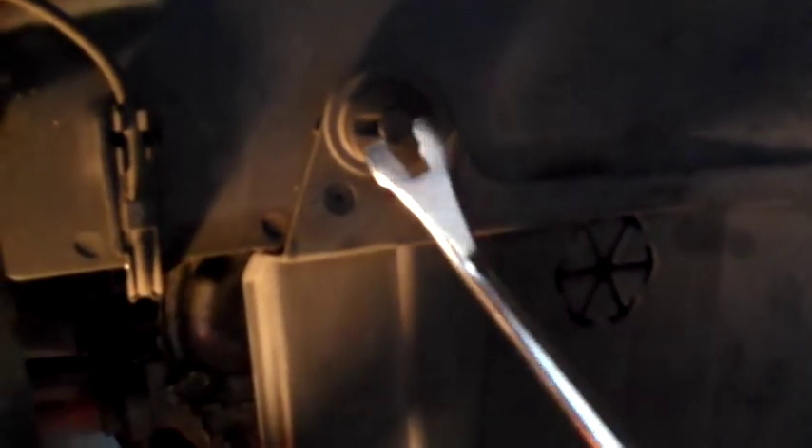So you've got the car in the air, you've got a light in place, support it on a jack stand. If you're going to do the water pump anyway, you're going to need to take off the motor mount on the left side so you can drop the engine down and get to that tensioner bolt. I'm also removing this plastic liner in here so I can have more access into that area. It's a pretty tight area to work in, so getting any extra access you can get is going to help you — you'll thank me for telling you to do that later.